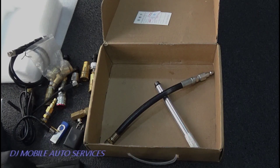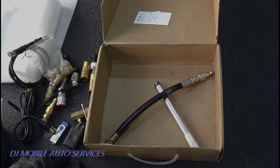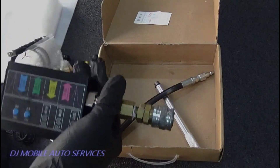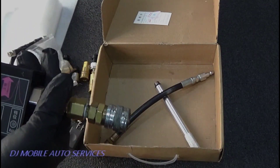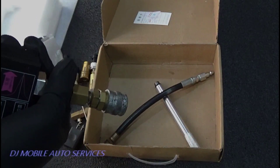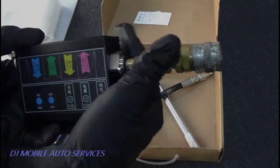I'm not saying this is better than the Pico in any way, or better than all the ATS transducers, but for the bang for the buck it does what it's supposed to do. You could buy this three or four times over for that money. I've tried it on fuel lines, vacuum, and in-cylinder exhaust — that's what I've tried it on so far.